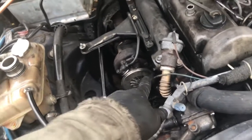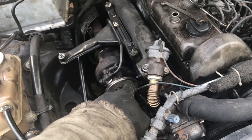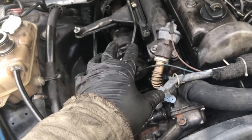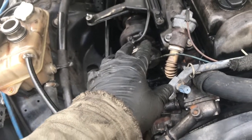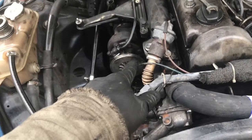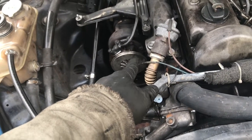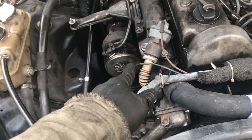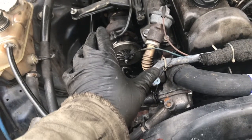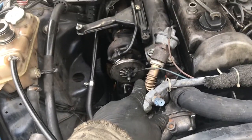And I did it without messing with that bottom bolt there. I got it just run up flush, not tight, flush. Tightened everything else, got it all torqued down, and then went back with an open end and tightened down that one that was hard to get to. And of course, at that point the turbo's where it should be, and we're not putting crazy amounts of torque on it like it took to get them off, so the open end wrench is just fine.